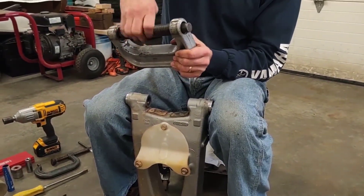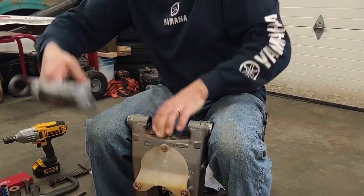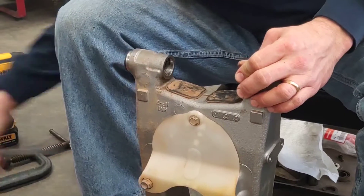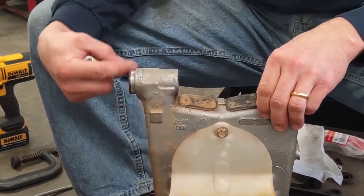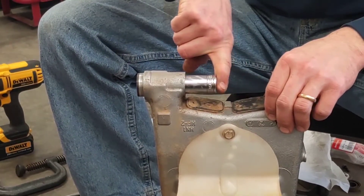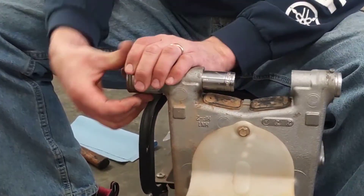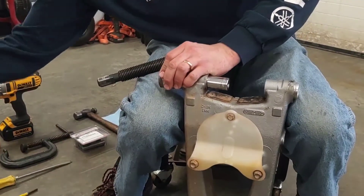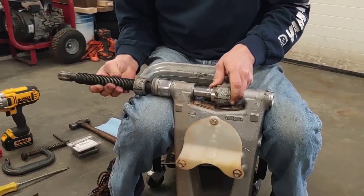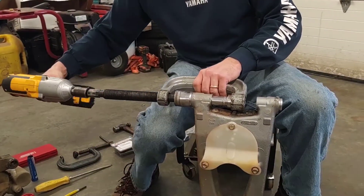I'm going to take our ball joint press. It gets stored with the screw in there like that. I'm going to take this out and turn this around — this is how it gets used. I'm going to pop up this little rubber seal here. Now the bearing is inside here, and there's a little steel collar here that has to come out as well, so we're going to be pushing it out in this direction. We have a socket that fits in here and rests against the bearing that slips through the swing arm. We have a larger socket that's bigger than what we're going to press out — we have a rest on the edge of the swing arm just like that. We have a piece of our bushing driver set that fits here into the ball joint press. Tighten this up by hand. We're going to take our electric impact gun, set it to tighten, and drive the bearing out.